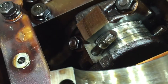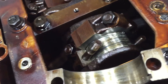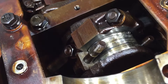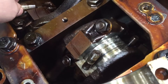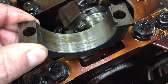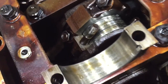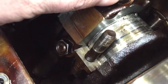I don't know how great a condition this crankshaft is in — it can always get resurfaced at least a little bit — but holy smokes, somebody definitely toasted a bearing on this. I'm going to guess this was used as somebody's drift block at one point. Everything else seems pretty tight, and that's not necessarily ideal. There's definitely been some material that's gotten into the oil galleries. The block itself seems fine, but I definitely worry about this crank.